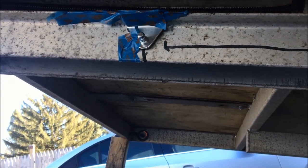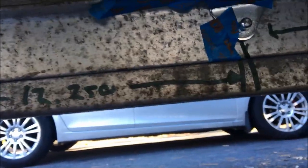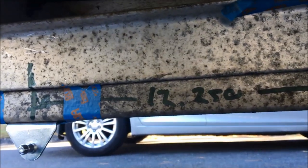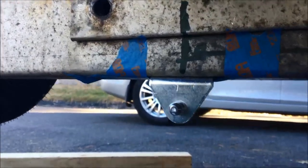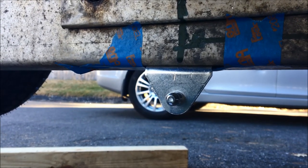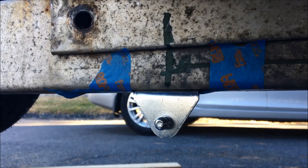With the trailer back down, make a line from the centerline of the first bracket at 12 and a quarter inches — 12.25 inches — draw another line, and then temporarily tape the second bracket to the centerline of that mark. Then open up the trailer again and check the distance between the two plates while they're open.